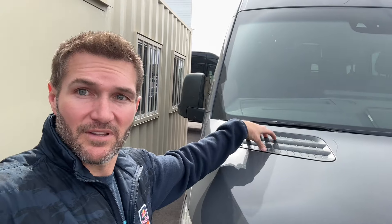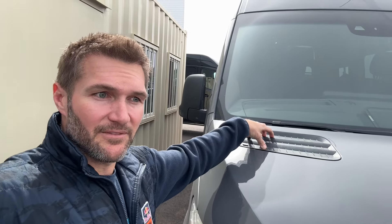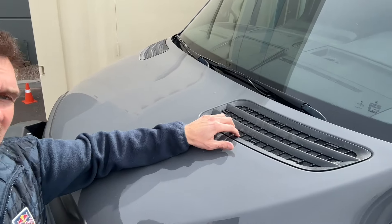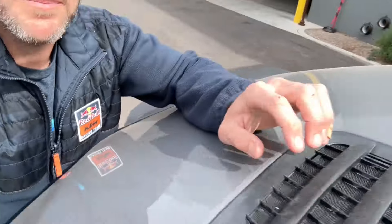But I don't want fake vents on my car, so let's make use of this — and also this. We're in Arizona so we get a lot of sun, and if you live anywhere really sunny, what happens is this starts to potato chip over time and get kind of wonky. This one is a screen — you can see it actually has air passed through it. That is not an engine air intake; that is your cab air intake for the HVAC — the heating and air conditioning inside the cab.